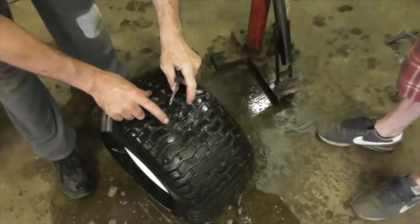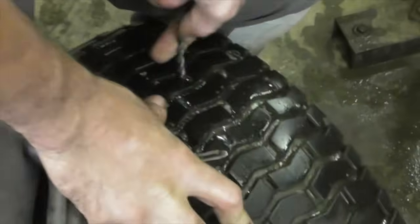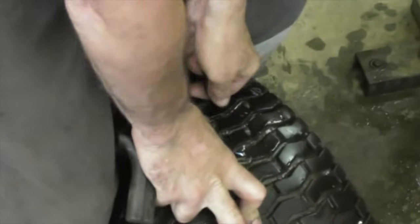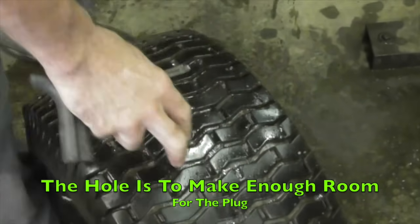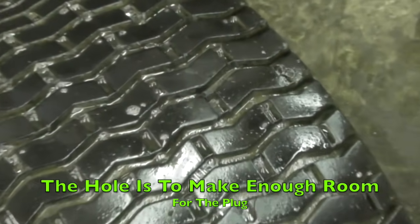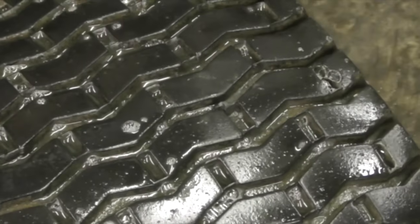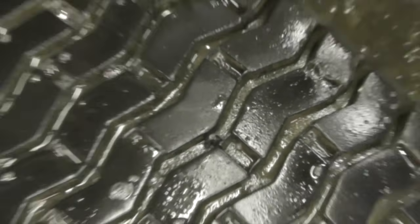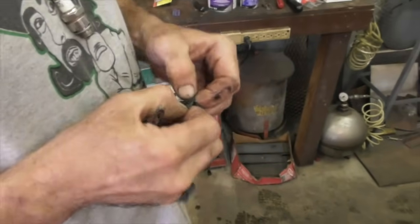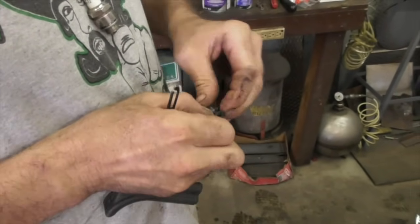So we find the hole, which is right here. And you gotta jam this in there. Like file it. Now it's really coming out of there. Yeah, now I put a big hole in it, Skip. And you take one of these here tire plugs. It's all stuck in there, or as you called it, licorice.